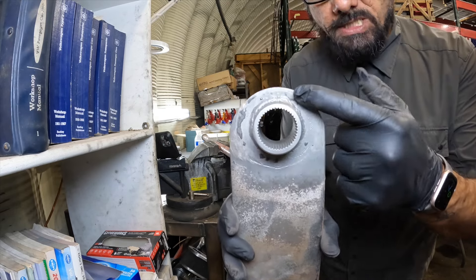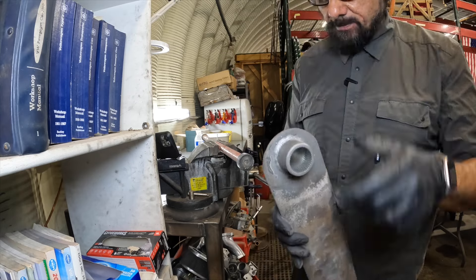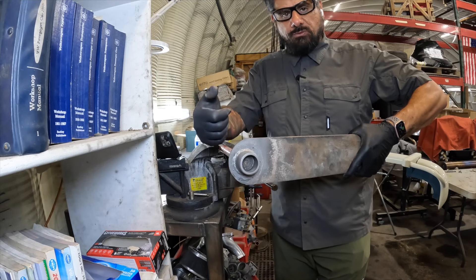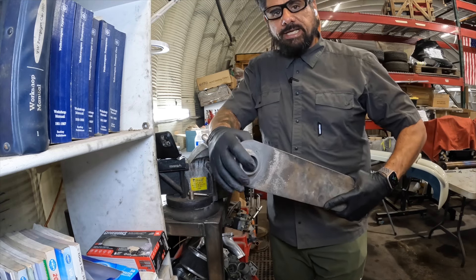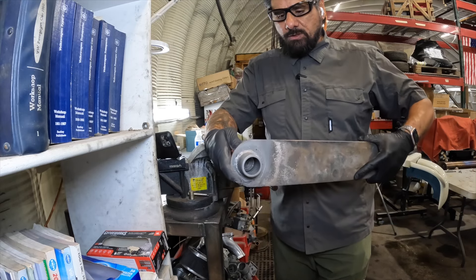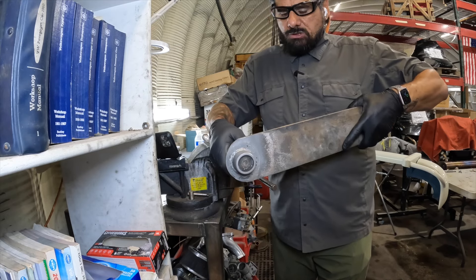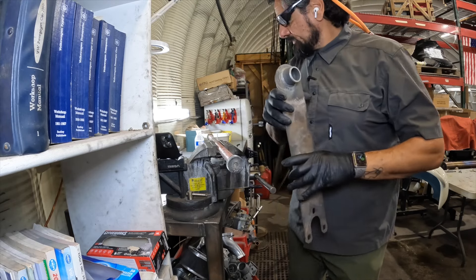On your spring plate you can see the cog right there — there are grooves that match these grooves. So if this is my right angle, meaning your spring plate sits here when it's relaxed, and I want to raise the vehicle, I take the rear suspension up — it comes down and re-indexes, and now that has just raised the vehicle. If I want to lower the vehicle, I bring it up and put it on, so now the vehicle rides lower. Just wanted to give that brief explanation so you understand what we're taking apart and adjusting.